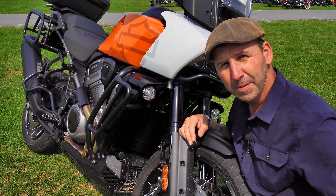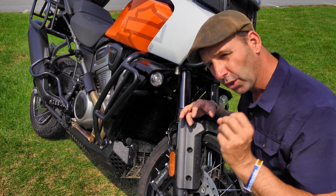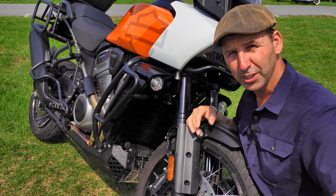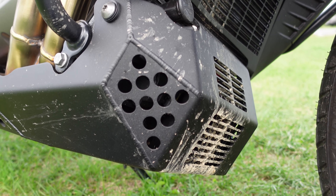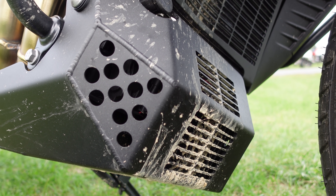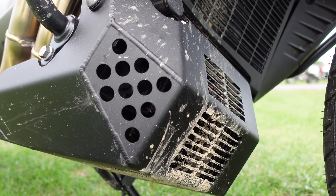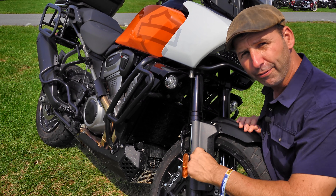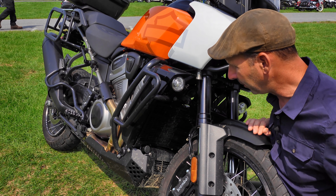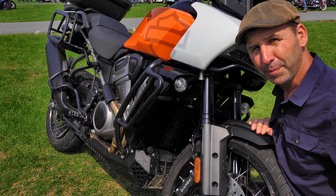Also, right down behind the front wheel is the regulator for the charging system, and that is right behind the wheel where it collects all that garbage — and that's also where I tend to bang up the bike when I'm doing really stupid stuff. This bike has a skid plate on it and that skid plate covers up the regulator and does a nice job, but it's still right there on the inside. If I hit something really hard and damage that area, that regulator's there. Also, once I pack it full of mud and muck, that's going to be a problem. I don't know if this is a real issue or a perceived issue, but it's definitely something I'm going to be watching for.